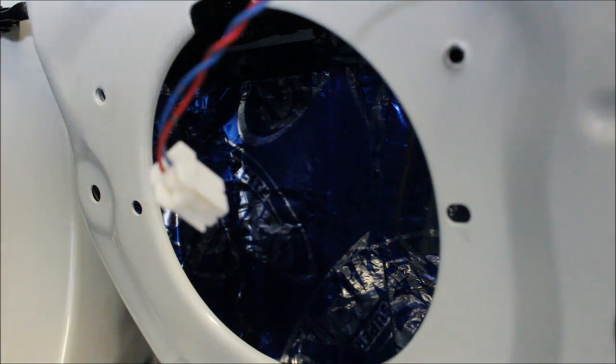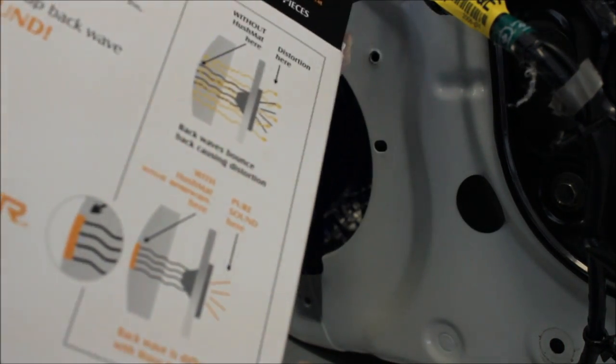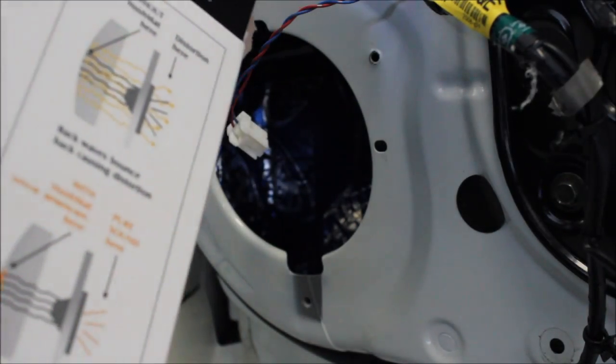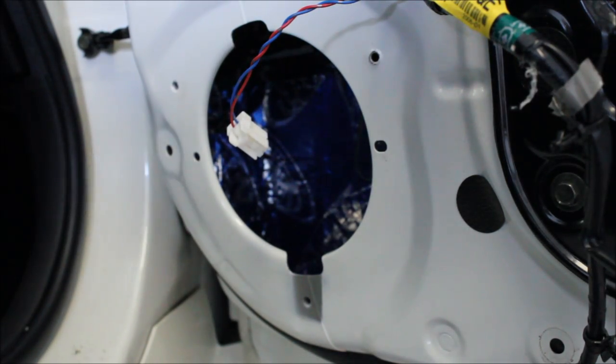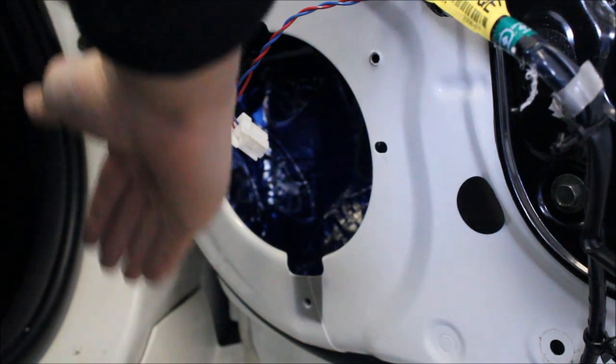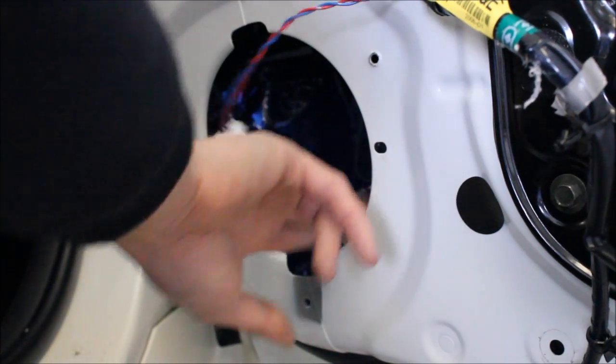The next thing we're going to do is put in Hushmat's Wave Breakers. It's a very simple thing but very effective. The idea is that speakers produce sound waves back and forth, but what we want to prevent is the speaker wave bouncing off the back of the door and hitting the speaker, because that's going to create distortion. On some vehicles, if the window comes all the way down behind the speaker, this cannot do its job — it's going to bounce off the window instead. In the case of the 350Z, I have the window all the way down and you can see clearly right to the back of the door. Any waves hitting the back will be absorbed by this, whether the windows are up or down.